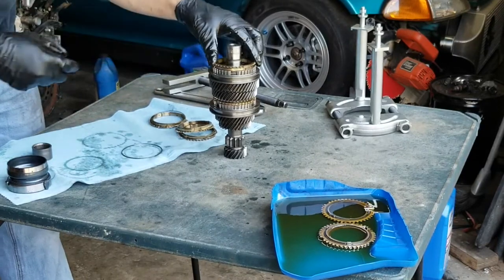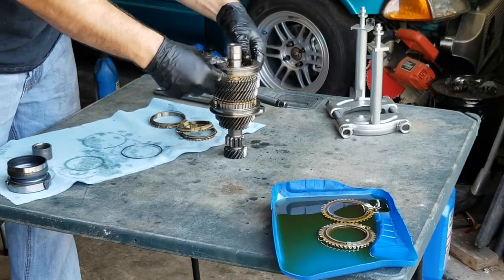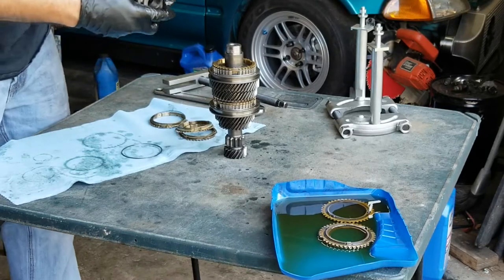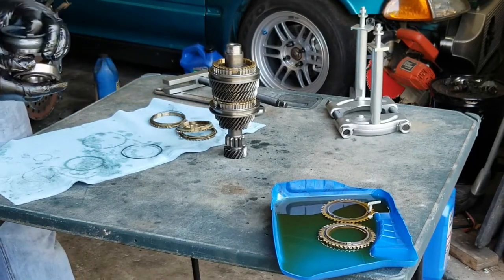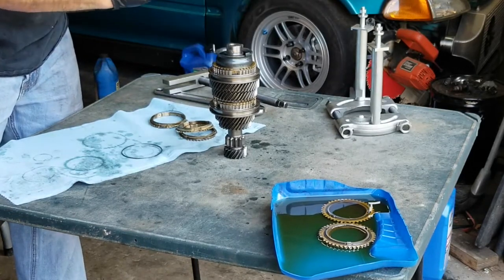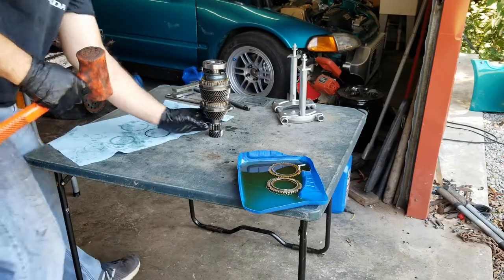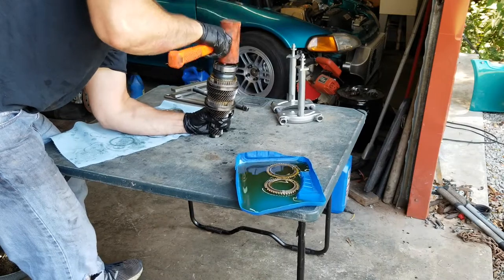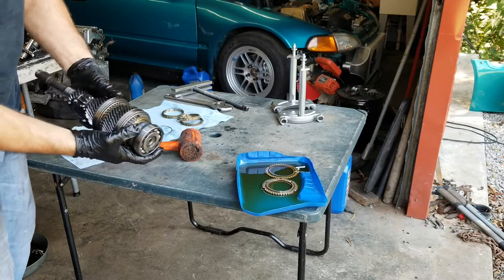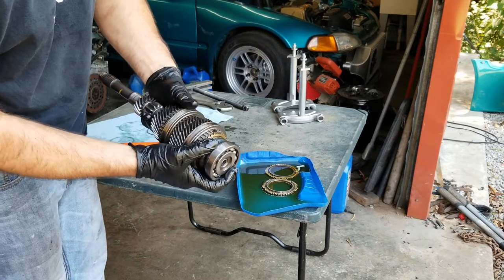You reuse the outside brass. Then our sleeve goes on. If you had a sixth gear, this assembly here is going to look a little different. Then we have our bearing. To get that bearing back on, I just tap it on there with a rubber mallet — it's not putting any force on it per se. Now it's back in there. Now we've got them all reassembled here on the main shaft. Now we're going to move over and do the counter shaft.